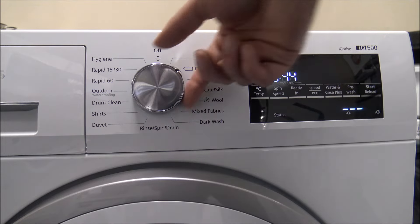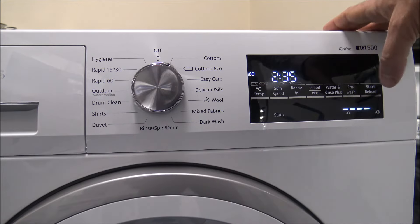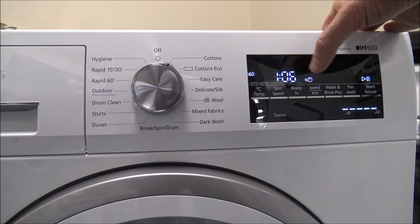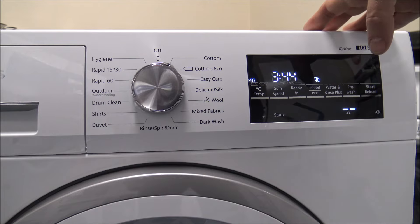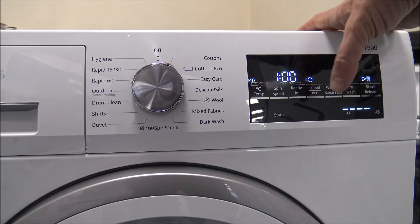There's another option called speed and eco. Some programs take quite a long time — you can see here that's two to two and a half hours. But you can press the speed button to reduce that program down to around an hour. On a 40 degree wash it becomes an hour, and for this program the maximum load is five kilograms. You can also press the eco button — don't be put off by three and three quarter hours, because the machine will actually adjust the wash time depending on the load size and how dirty the clothes are. Selecting eco is a much more efficient way of washing, and you can find that performance is a lot better, especially combined with the speed option.